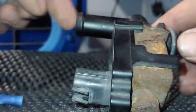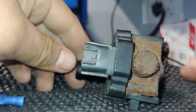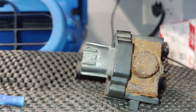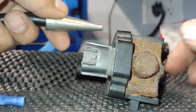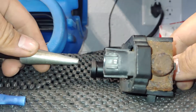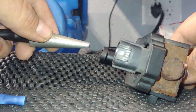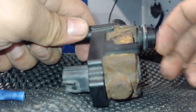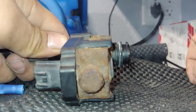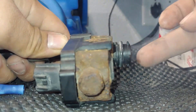So I'm just going to position it like this, but keep in mind the inlet is going to be here. Smoke should be coming out of here. Let's go ahead and get the smoke machine going. It just takes a second for it to warm up. Alright, we've got some smoke. So here it is with no voltage going to the plug — it is open and just going straight through.